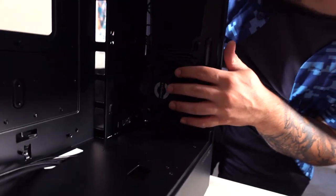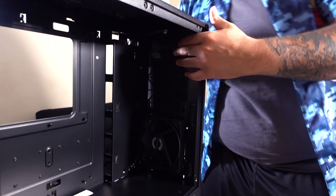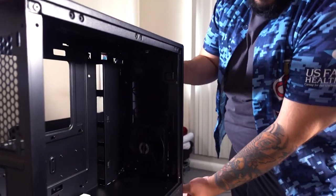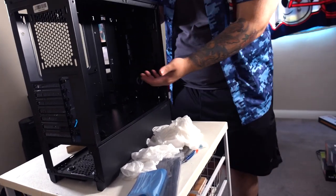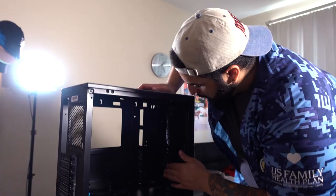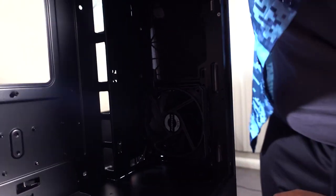Alex is here, we're ready to start building this monster. There's already a pre-installed fan in the case — you can think about a couple of configurations. You have a dual-fan cooler, so you can pull cool air from the front. The only issue is there might not be much airflow because it's quite limited. I recommend positive airflow where everything pulls cool air from the front and pushes hot air out the back. I'm probably going to install the radiator on the front.